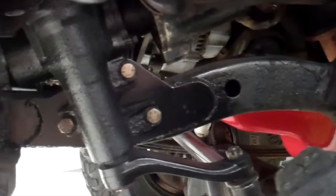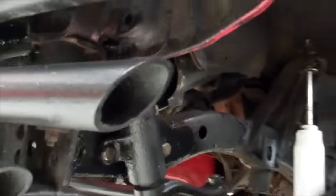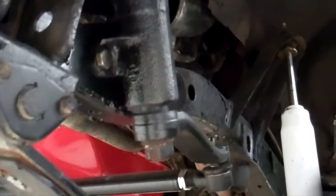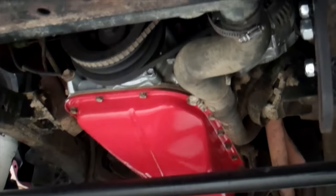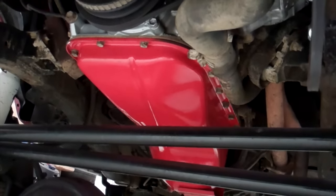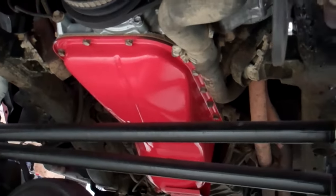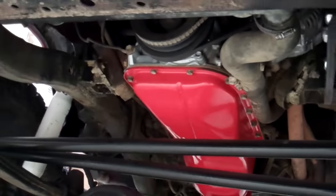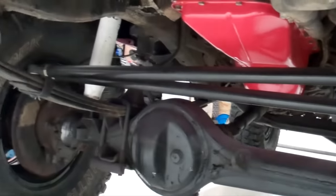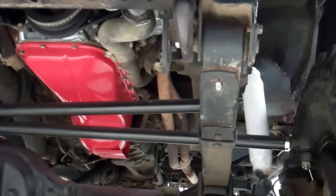Underneath here are a few new goodies. I went with a Trail Gear high steer kit and got an IFS box mounted up in the frame. I got that all painted up — it's looking fresh black. The oil pan was chipped up and a little rusted — actually painted the same color maybe more or so years ago and it just didn't hold up that well. So that's got some fresh paint on it. My skid plate no longer fits because of the higher raised steering link, so now everybody gets to see my pretty new oil pan.